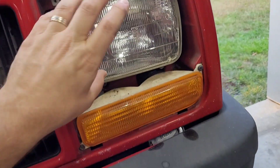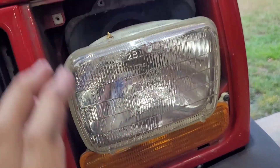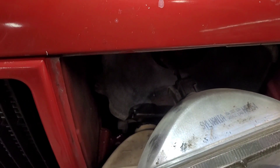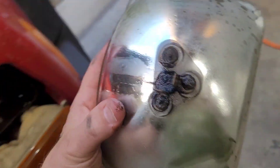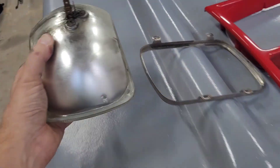This is what holds your headlight in. Once you get that off, the headlight should just kind of fall out. Be careful — if it's not completely connected back there, you will drop it. Now sometimes these plugs are hard to come off, so a lot of times I will spray some penetrant on there to try to loosen them up a little bit. There are the connectors there.